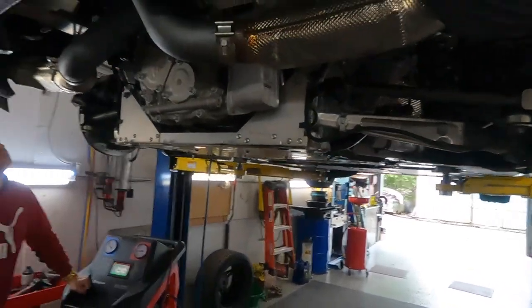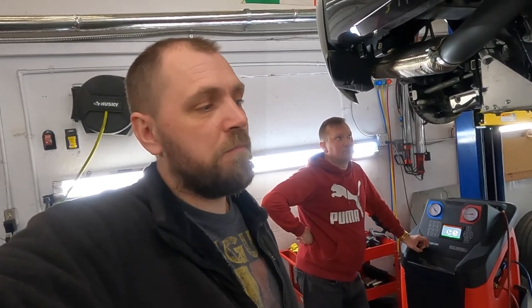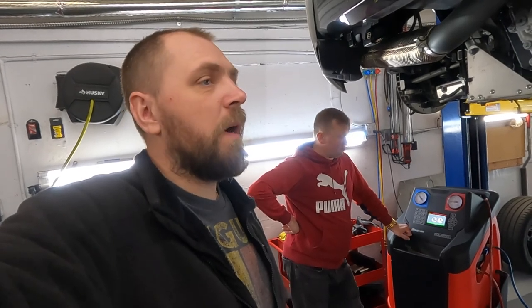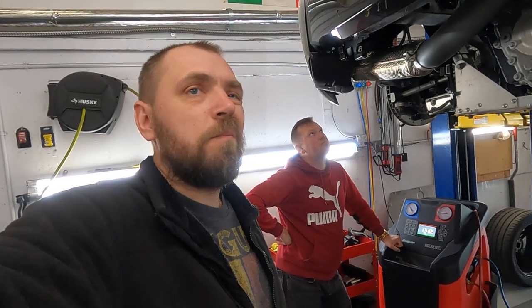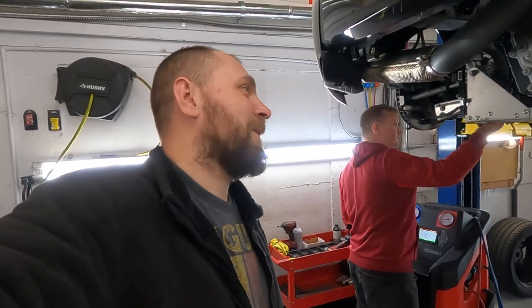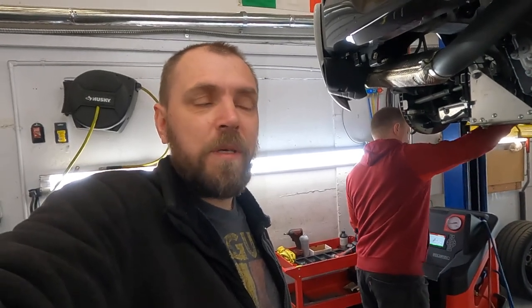We need to warm up the whole system the proper way, make sure no leaks, and I hope this is the last thing. But just like yesterday, we investigated a little bit what happens and why it happens like that. I think it's just vibration, and this really close metal clip that holds that wiring harness probably cut the wire and maybe shorted. And this is only that area, I mean all the wire around that area, no more. The most burned wire came to the blow off diverter valve, let's say diverter valve, right? It's not blow off, but the diverter valve, sorry guys, it looks good, it's working, we checked resistance from left and right side, everything is good. I think just vibration, and we replaced that part of the harness, and I hope no more happens. Let's see.